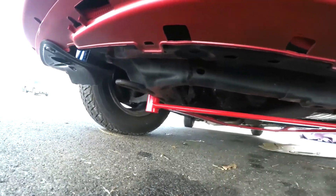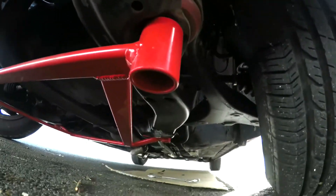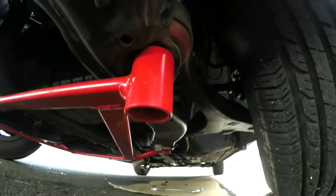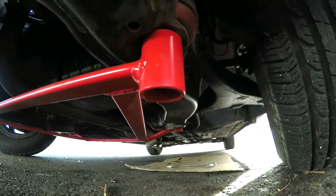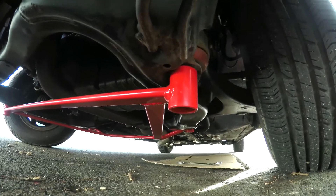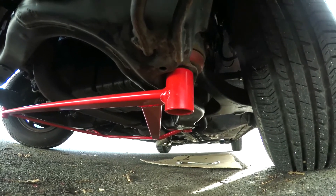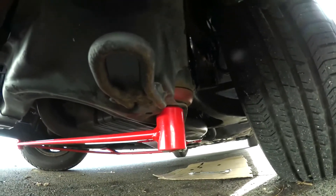These front two bolts have to come out. They are the front control arm bolts. They are 19 millimeter or three-quarter, and I would suggest taking them out with the car on the ground, because you could jack it up to get them loose, but they are a pain in the butt to get out if the car is jacked up. The same thing goes with putting it back in — it's almost impossible with it up in the air, because of the stress on the control arm bushings. It has them slightly cocked.